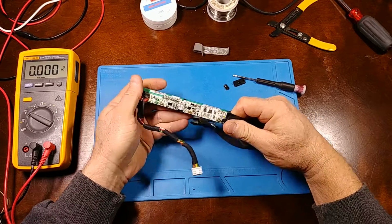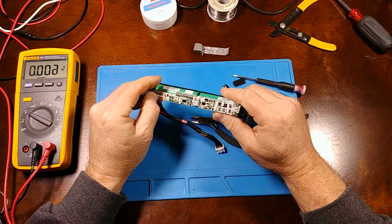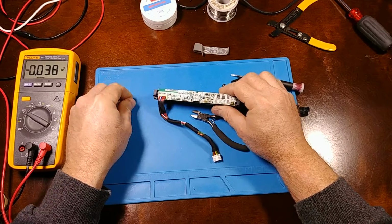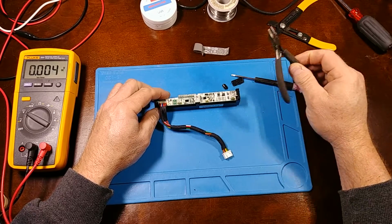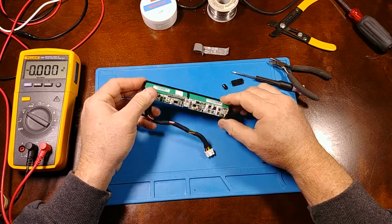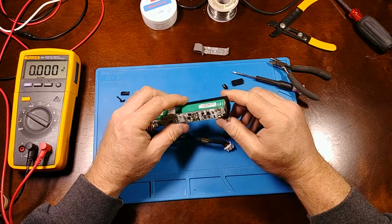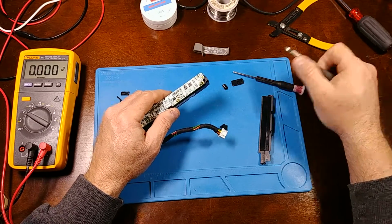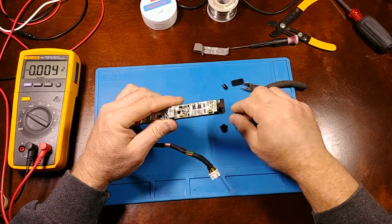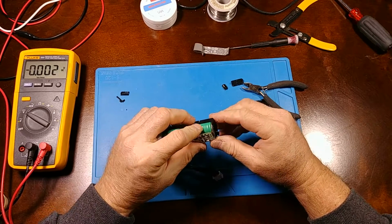So there you can see the electronics. This is the battery management electronics. What that'll do is control the charging of these batteries to make sure that they don't overcharge, and of course it will monitor the temperature and make sure that they don't overheat and that they don't over-discharge as well. So it will cut power to the device if the batteries were to get too low, which shouldn't really happen, because again, this is just for keeping memory powered up, which should be a low power application. Shouldn't happen for too long, hopefully, in a server.